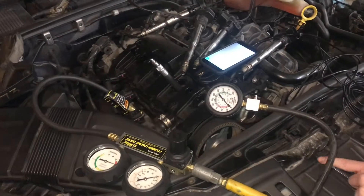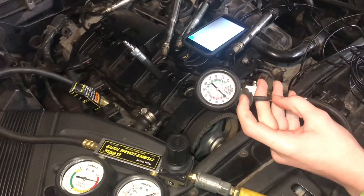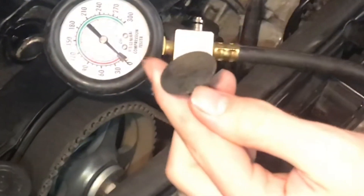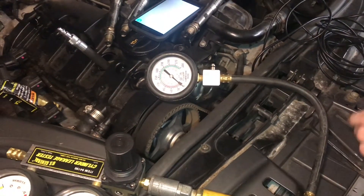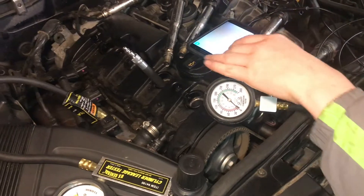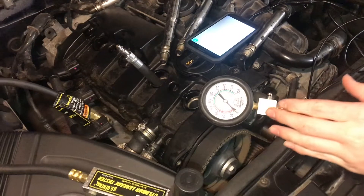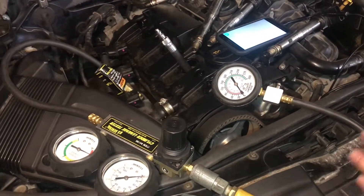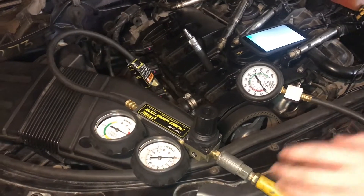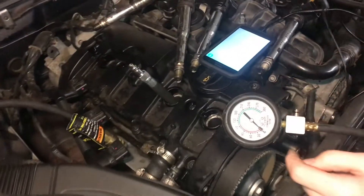We'll take a look on this engine. What we're looking for is a burnt valve — kind of like this with a chip out of it — or a bent valve like that. We know we have something fishy with this cylinder. We can hear it coming out of the intake valve. The compression test gives us 150 but all the other ones are 185, and we got about 35% on the leak down test. So there's something fishy going on with this cylinder.